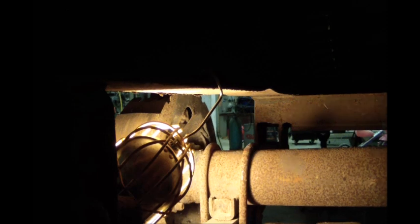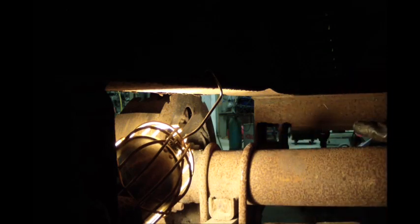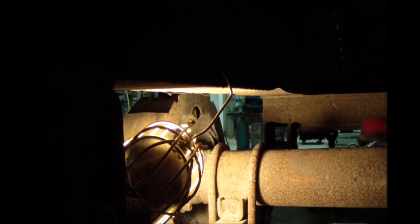Okay guys, I'm going to put you under here. I'm going to go ahead and cut these spring U-bolts because they're just too hard to... The nuts on them are so froze up. Everything on this, I'll pull you out of here shortly and show you what the equalizer bars look like. Everything has been a fight, all frozen up, rusted up. Impact gun's not doing anything for it, so I'm just going to cut them.